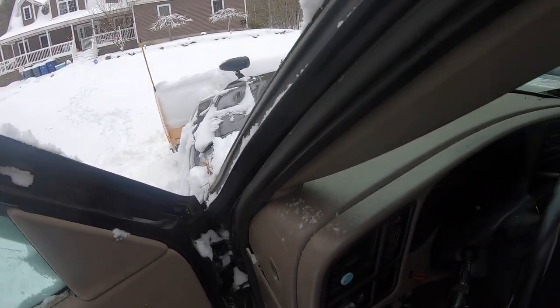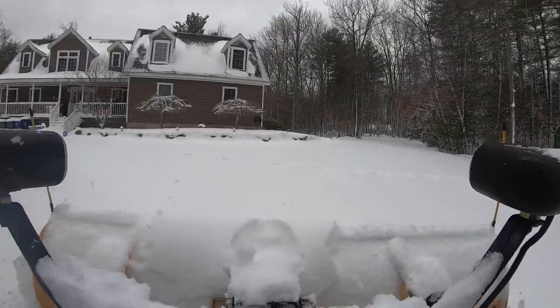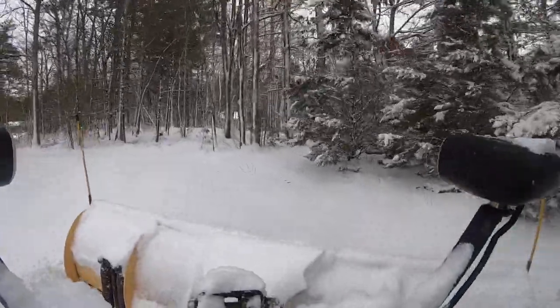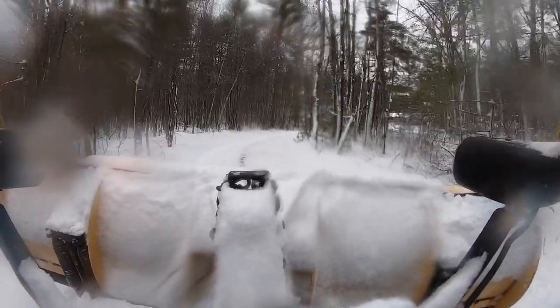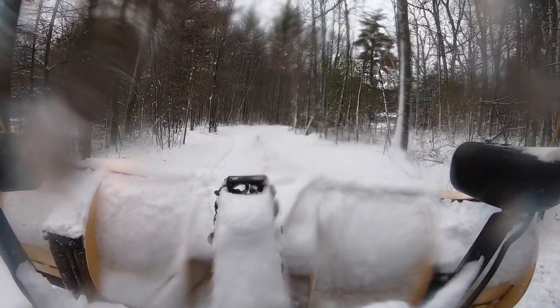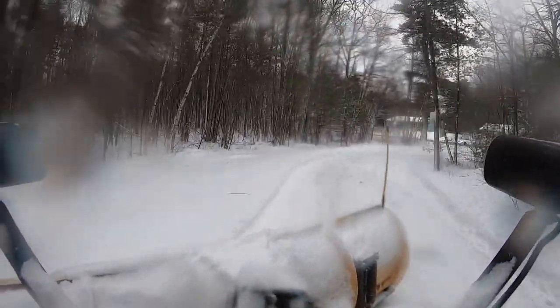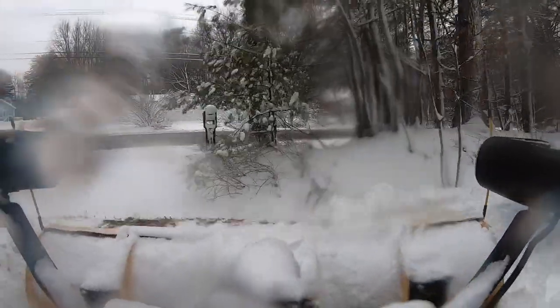Let's hop in the truck, put you guys on the hood, and go plowing. First thing — we're going to angle the plow to the right, and I'm hugging the right edge of the driveway. As we come up to the final snowbank, we're going to straighten out and lift the plow. You don't want to just slam into it — it's hard on the plow and hard on the truck. Another tip: when you back down the driveway, back down your previously plowed area.